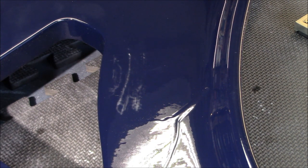The run is in a weird spot — it sort of slopes down to the opening for the vents, preventing me from getting a good straight level edge on top of it. I'm going to have to go old school and go with the small sanding block, paint stick, and 1000 grit, where I'm more comfortable anyway. Let's see how we do getting that out with the 1000 grit.